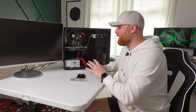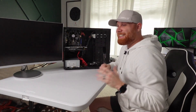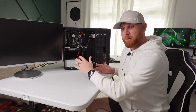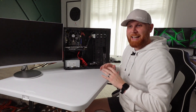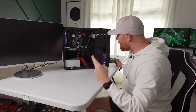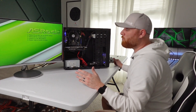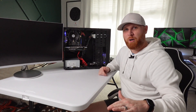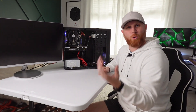Always make sure your power supply can accommodate what you're trying to do. You have to excuse the cable management - these cases have no ability to hide anything. With pre-built systems like HP's and similar, the PSU wires are always short, made to only fit a specific case. This power supply's wires were still too short even for the case it came in. To fit this graphics card, I had to run the CPU cable up behind the graphics card into the corner - that's all the room it had. Let's see if this thing will fire up. Fans are spinning, graphics card's spinning - we're at five or six computers in a row without an issue, which is impressive given the condition these systems are in when I get them.